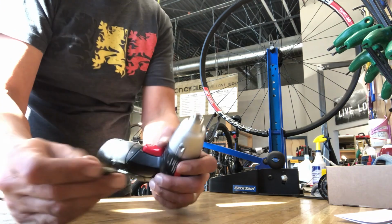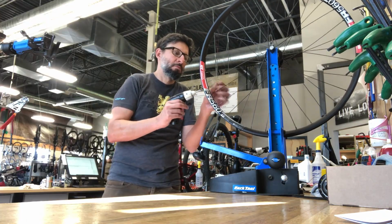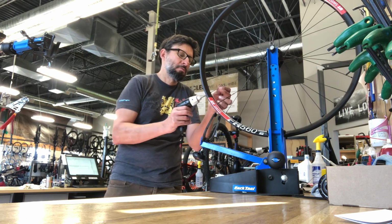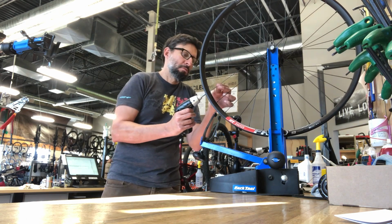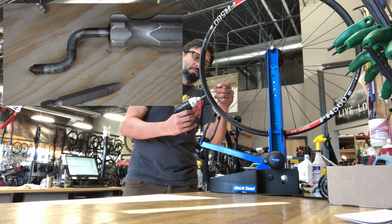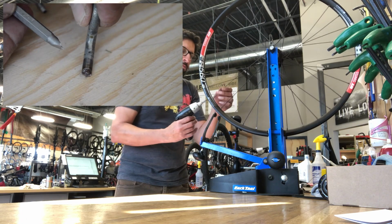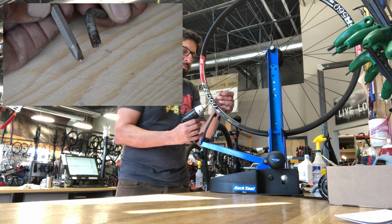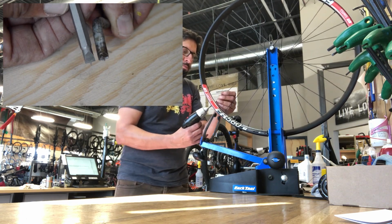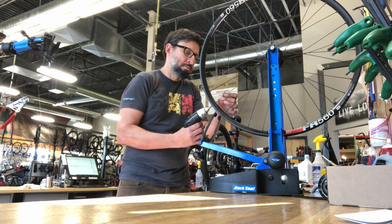I like using these little bits. It's a little homemade bit that I made, basically a flathead screwdriver with a little tip in the middle. You can buy these commercially, or you can get the little pigtail tools, which I'll put links to in the description. But those are nice. They're going to set you up for success as far as quickly and evenly getting all the spoke nipples tightened to a consistent depth on the spoke itself.